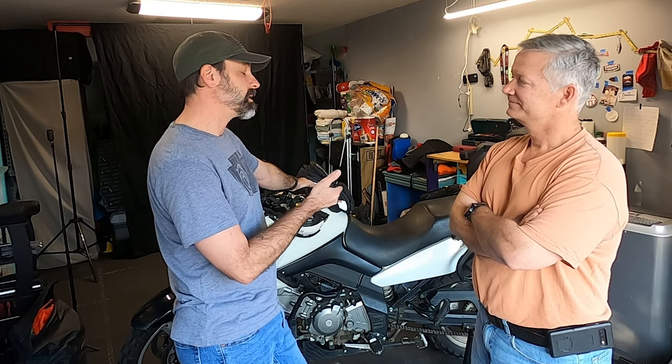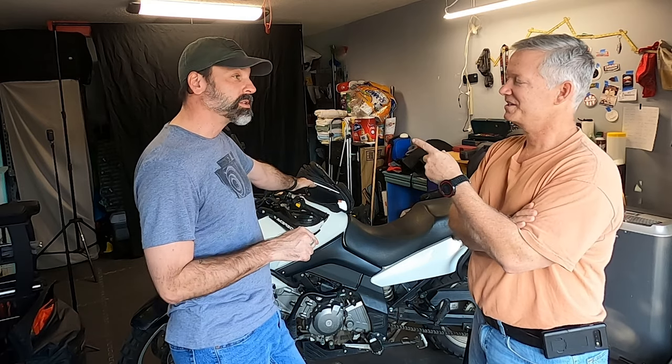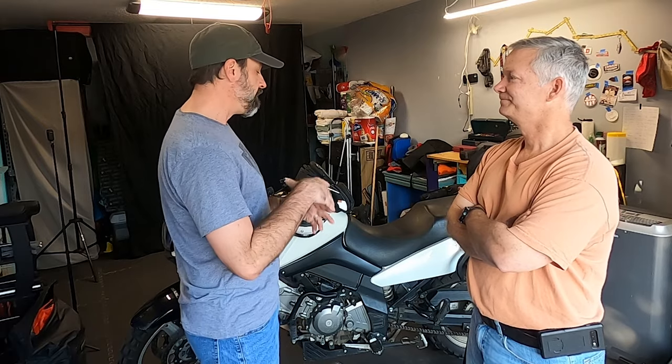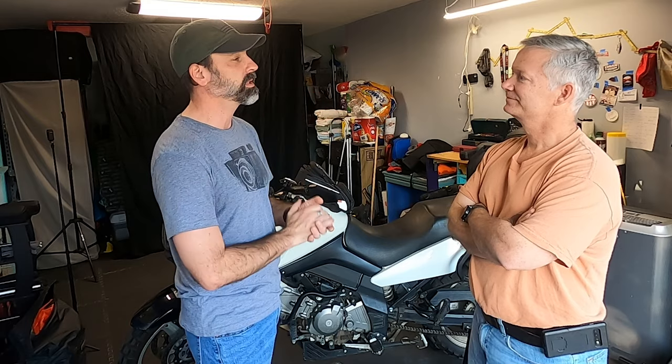over 18,000 miles on it now. But it's a 10-year-old chain. It's not a lot of miles for a chain or a sprocket, but it's a lot of years. Rusting on the inside. So I figure we'll replace both the sprockets and the chain, start fresh. That way I know where I'm starting from, mark it on the calendar, et cetera. So today is the day for those three things.